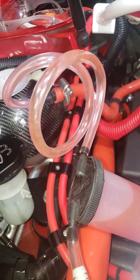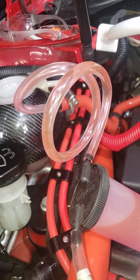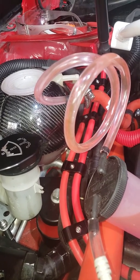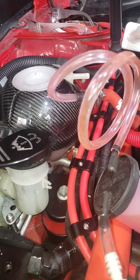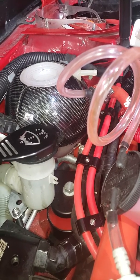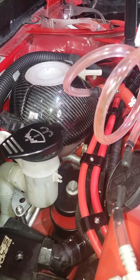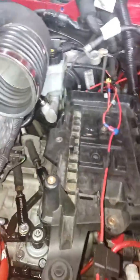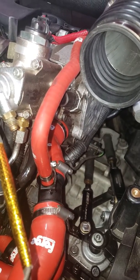When you start the car, watch the level with the heater on in case something came out of the heater core. But besides that, that's the quick, easy, fast way to fill up your Volkswagen's coolant system completely full — that way you don't have to worry about self-burping and overheating issues that come with just turning it on and waiting for it to heat up. Hope that was a helpful tutorial. Take it easy and I'll talk to you next time.